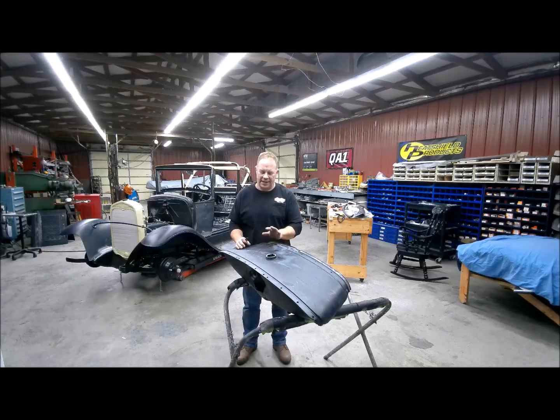I had it earlier when I did the etching on it, but I just kept getting old resin gas, lacquered gas out of it, and a little bit of rust. So I ended up taking this thing outside, and I put Purple Power in there, sprayed it around good, and then pressure washed it for the longest time, and then just put water down in it and just let it run and run and run until it boiled out crystal clear.